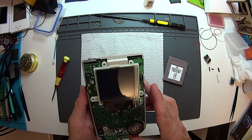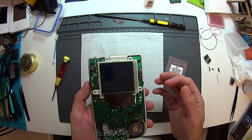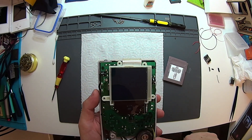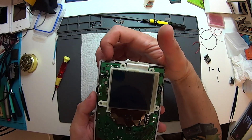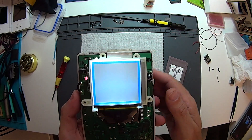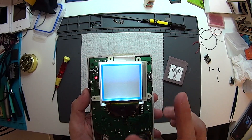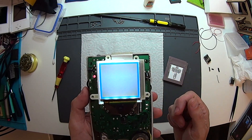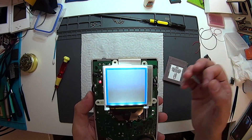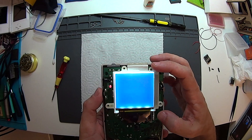We're back. We left that for about 10 minutes switched off and let everything cool. Most of those lines are evident when I switch on, so if it hasn't worked we'll probably get a little flicker and I'll just do the same treatment again. I'm expecting it might happen but it shouldn't be as bad as before. Let's switch on — no problems at all. That's probably fixed it because it was just a small minor intermittent fault that would flicker on switch-on and then disappear. If I apply any pressure or knock it, there's no flickering. If I turn the contrast completely the other way, there are also no signs of any lines or gaps. So we should be okay.